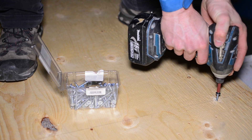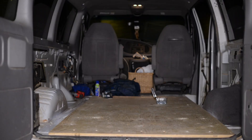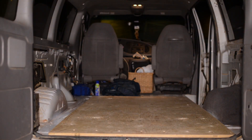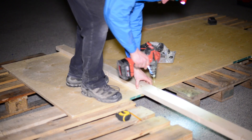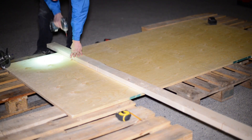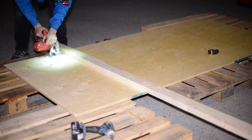With Cameron stripped naked inside, it's time to add a floor. I screwed down plywood using self-tapping screws. It's important to check under the van first to make sure you're not going to put any screws into fuel lines or other things you don't want to hit. We chose to install the floor so we can slide our storage boxes in and out easily, and also it gives us something to attach all the inner framework to.